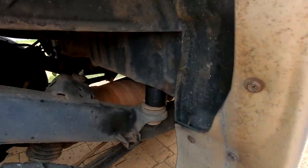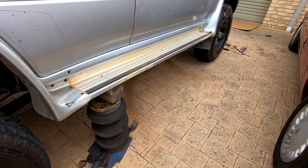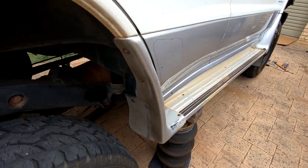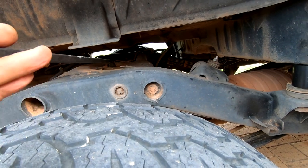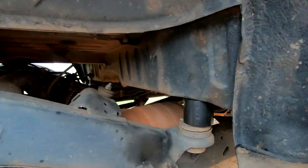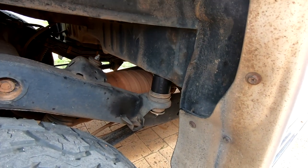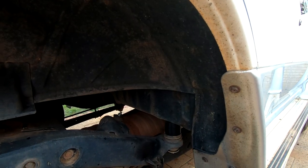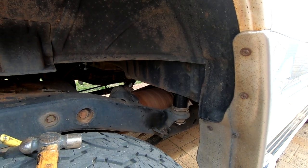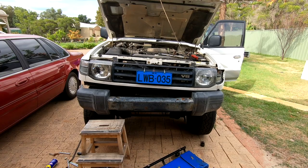Just come to put this one in here. Jacking the car up there, but because there's not a lot of weight on the back of the car it's actually taken the chassis with it a bit. I really struggled to make room, so I got a pry bar between the chassis and the body and just prised it up enough to wedge that in — it's literally just wedged in so I'm going to have to knock it into place and get the bolt in. Based on that I think I'm going to start on the other side, work front to back — by the time I get to here I'll have eight of the twelve in, and the last four at the back should be relatively easy.